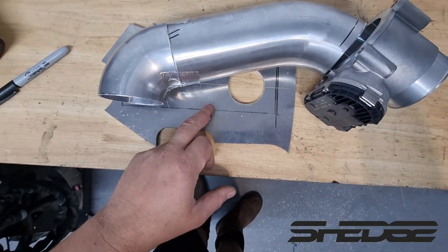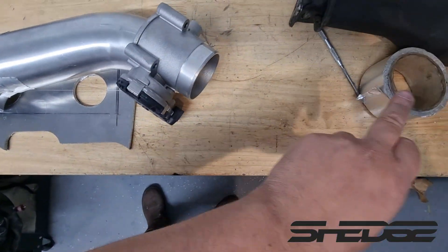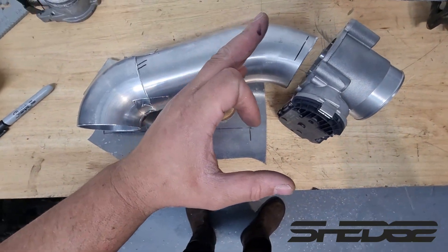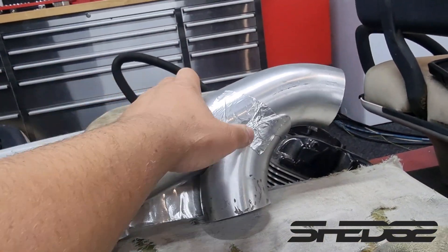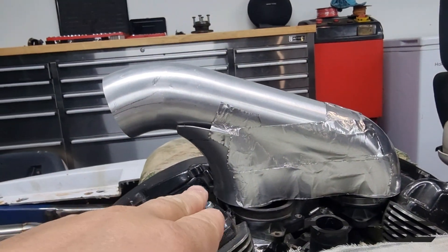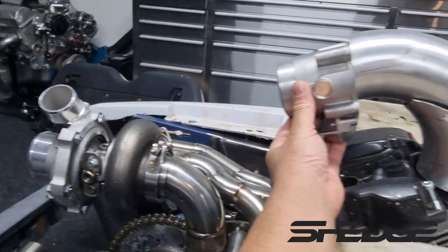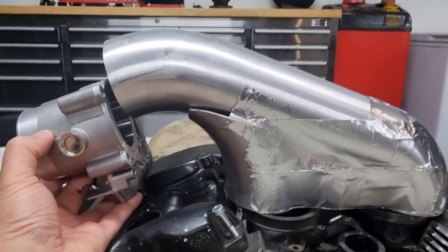As you can see this angle is probably a little bit too steep - the drive-by-wire may hit the head, and I think this angle is going to be too much. We don't want to kink the charge pipe down then draw it back up, so we're going to cut this back up on an angle so it'll be more parallel from the charge pipe straight up into there. You're always better off having extra length here than cutting it too short. We've notched the front one out, roughed it out. It's sitting a little bit high so we'll take a lot of the bottom out. We'll have a lot more clearance here - it can drop down pretty tight, and we should still be around 1.5 times the volume of the motor.